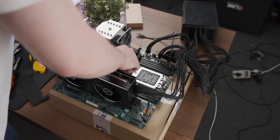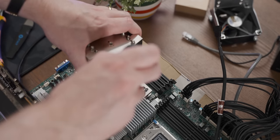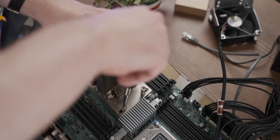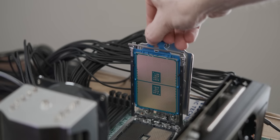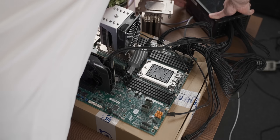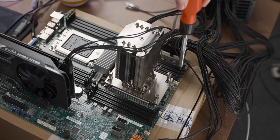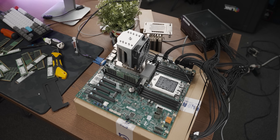It still doesn't work. Let me swap the RAM stick — that doesn't work either. So I swapped the CPUs into the other socket. I spent the next couple of hours trying every combination of CPU, socket, and RAM. I did make a bit of progress — got some fans spinning at one point — but that helped me conclude that one CPU is definitely dead, the other is maybe dead, and the motherboard is maybe dead. I then took the whole setup to a local recycling shop where the owner and I tried all his various ECC RAM sticks, and we still couldn't get it running.